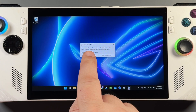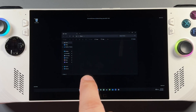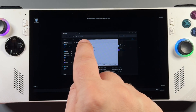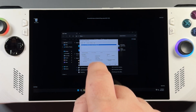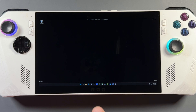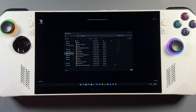You will have to uncheck this to turn it off once the uninstall is done. Click Restart and it'll bring you to safe mode login. Once in, go back into System Configuration, go to the Boot tab again, uncheck Safe Boot, and click Apply — but don't restart yet. That way when DDU restarts the device, we'll go back to normal mode.